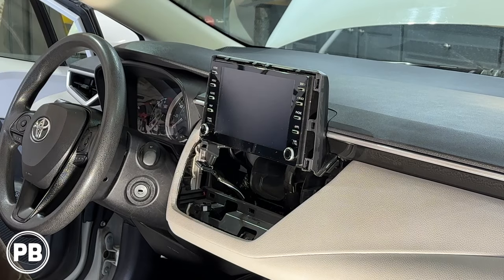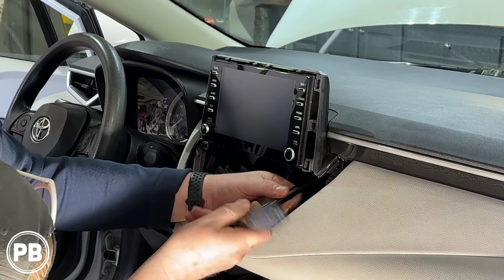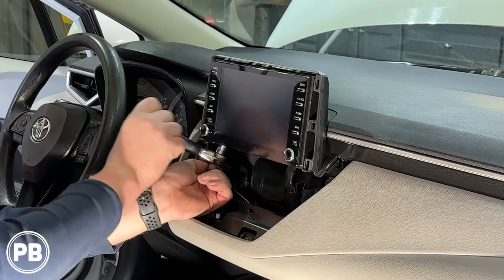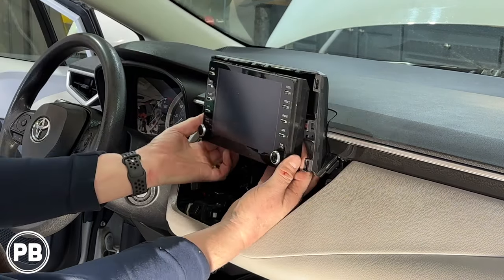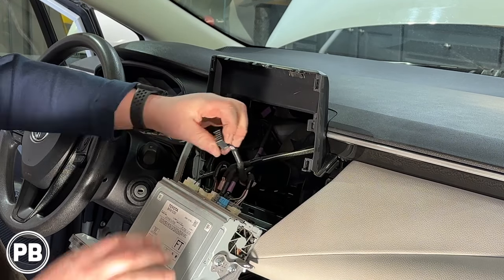You're going to have four 10-millimeter bolts holding it in. We have a socket with an extension to help reach those bolt locations. With those four bolts removed, let's go ahead and unsnap the radio. You're going to have plenty of length to get in here. The nice thing is there's a four-pin harness that has all four of your speaker wires. There's a T-harness or extension harness available that you can use versus tapping into this plug — we can link that in the description — and it's color-coded to aftermarket color code standard, which is awesome.